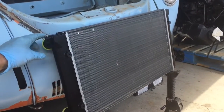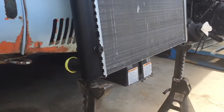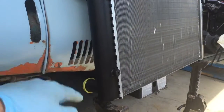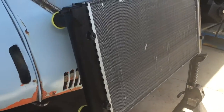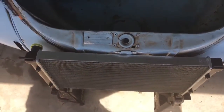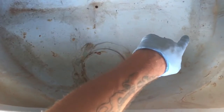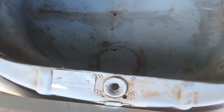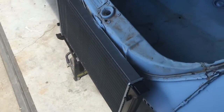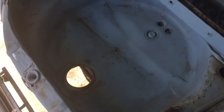The radiator has shown up — this is from an early Volkswagen Scirocco, and I've got it on jack stands. The Super Beetle has this grille, and hopefully that'll be enough airflow to cool this radiator. What it's going to take is cutting out the A-box right in here to mount the radiator and create a pathway for the exhaust heat to escape. That's what I'm taking measurements for.